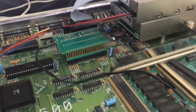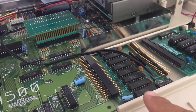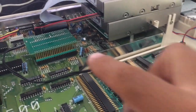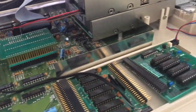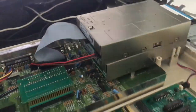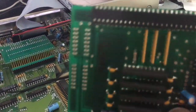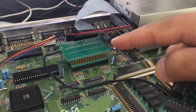We've got a Gary adapter here, which is really nice. It allows me to plug in this half-megabyte fast RAM with daisy chain and also use this 1.5-megabyte RAM expansion. It's a nice combination, but it can only work if you have a Gary adapter. So if you have a Gary adapter, I really want to buy one from you, because I have six or seven of these 1.5-megabyte RAM expansions laying around — I also have them in a different form. In a standard Amiga 500 they only work as half a megabyte without the Gary adapter. Please mail me!